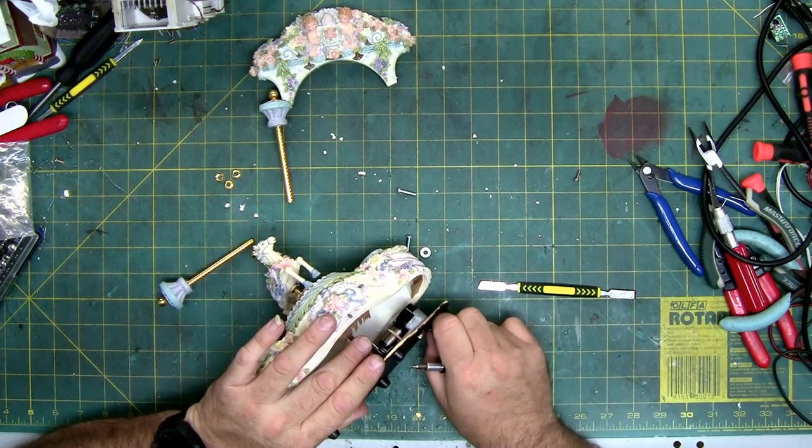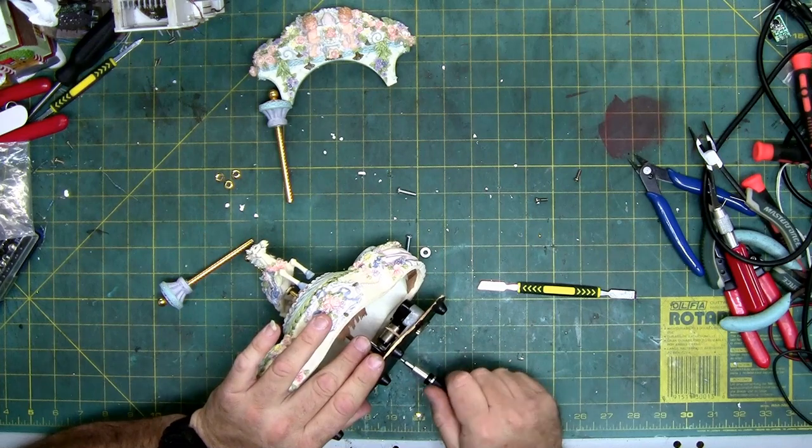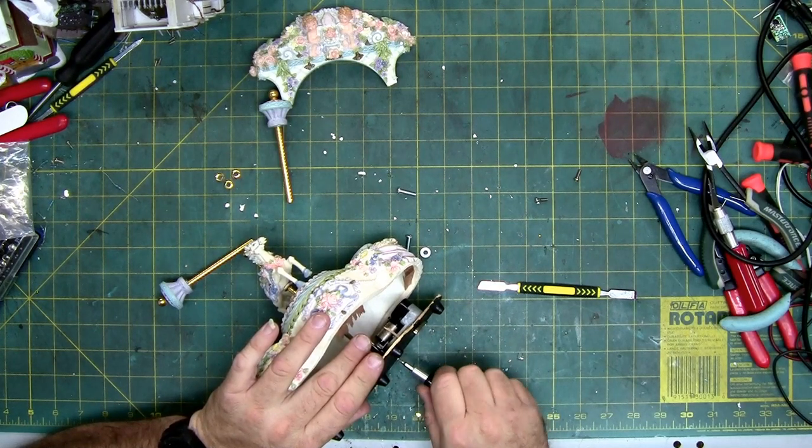If you have a station or you're thinking about getting one, the heat gun will run until it cools down to below 100 degrees C, which is 212 Fahrenheit, before it turns off so that the coils don't snap.